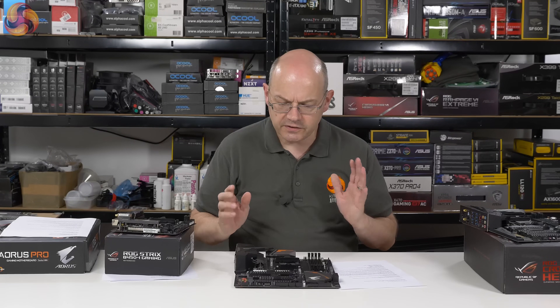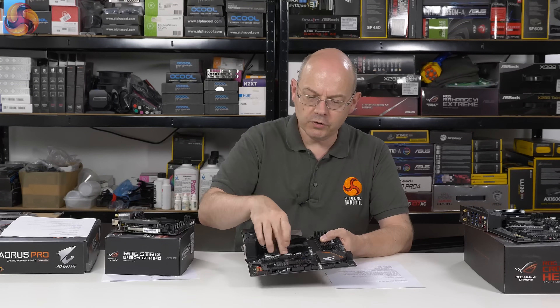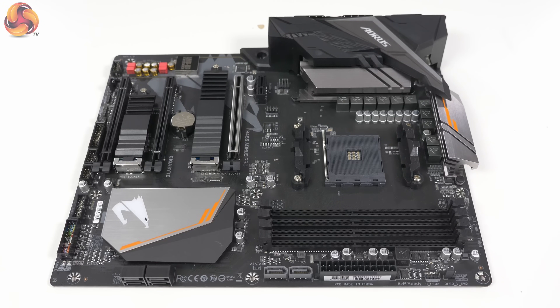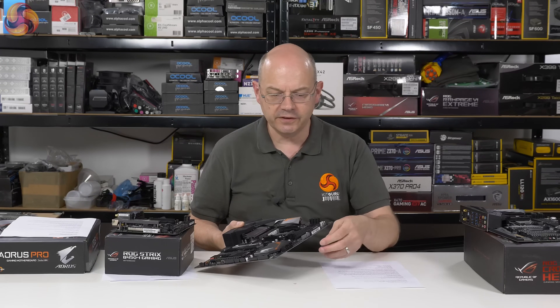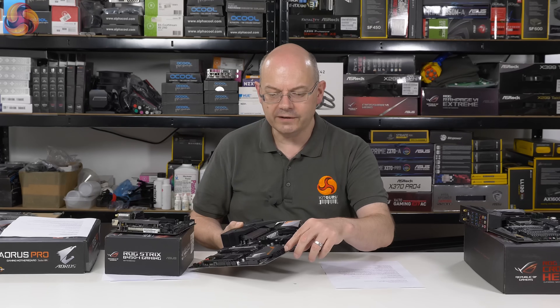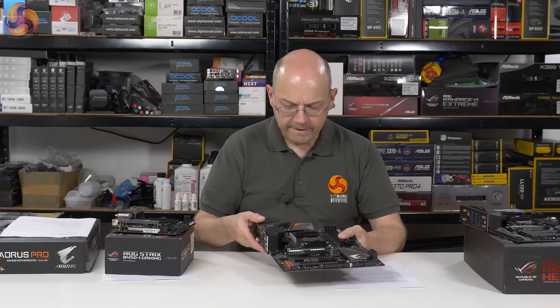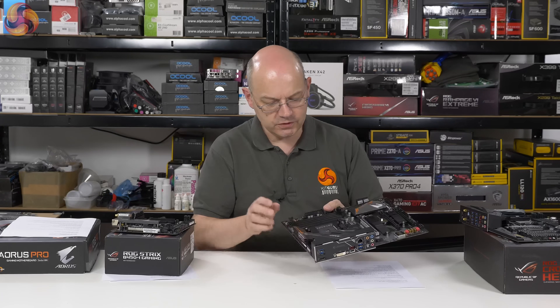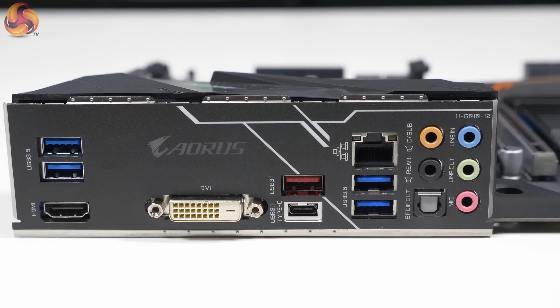In terms of features, they actually have more going on than you might at first glance think. This is an ATX board — single PCI Express 3 slot, dual M.2, so that half the board is used, four memory slots. You've got a slightly weird thing going on with SATA: four SATA laid down there, two SATA stood up there — no idea why. Headers and connectors at the bottom, audio over there, a little bit of redness for aesthetics. We've got an EPS power connector at the top, main power connector at the side. On the IO panel, we've got DVI and HDMI output but no DisplayPort. USB 3s, Ethernet, USB 3.1 — one Type-A, one Type-C — and audio.